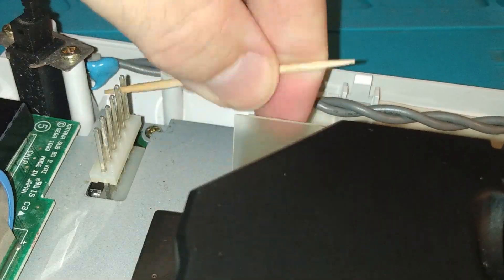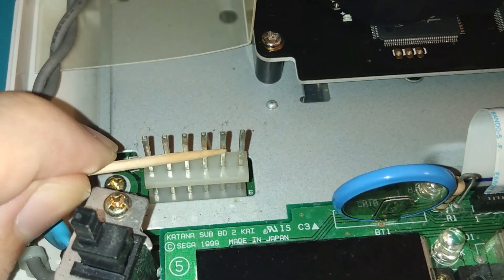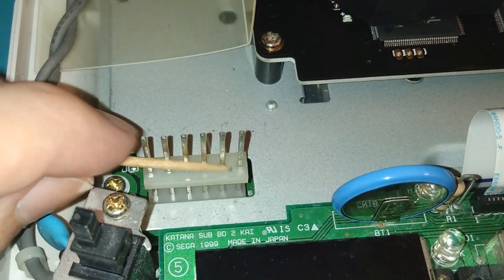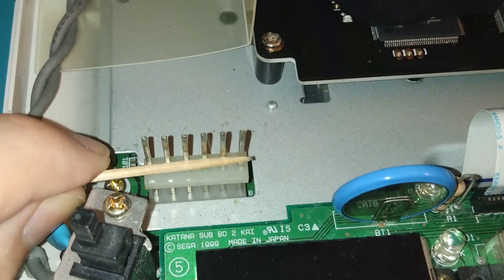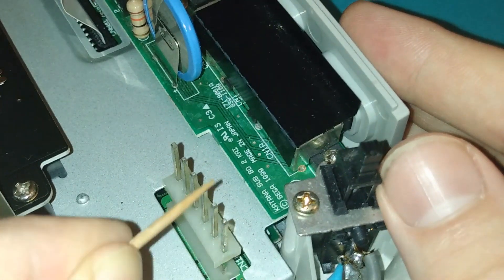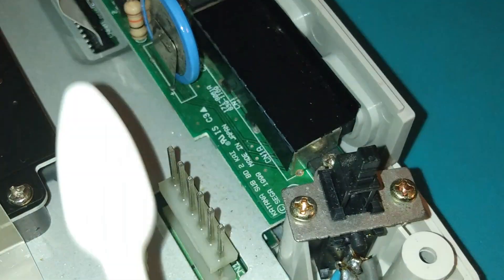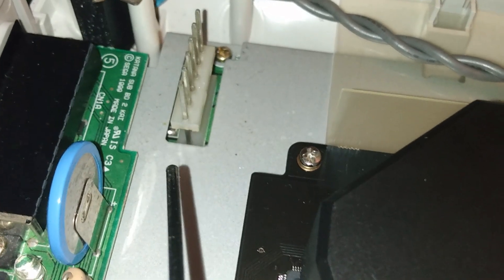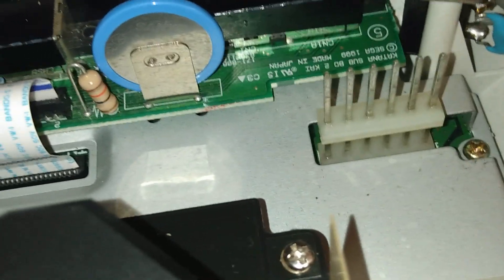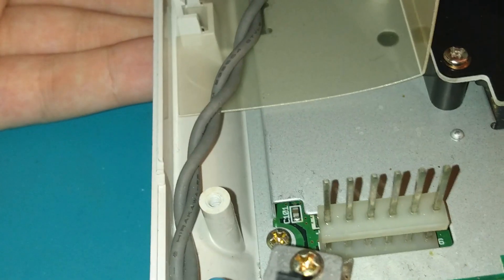I live on the east coast of the United States, where there is a high degree of humidity that accelerates rust and corrosion. In the case of the Dreamcast, the big aluminum pins sticking out from the motherboard have a lot of surface area exposed to air and therefore humidity and moisture at all times, slowly building up corrosion until it becomes a legitimate problem that prevents the motherboard from getting the appropriate power it needs. There's just a little bit of grime — barely anything on the tip. Just as Molex plugs and battery terminals build up corrosion, a fix is dielectric grease. The discoloration is still evident; the best way to fix that would probably be electroplating. But you can see some shine on the pins again.